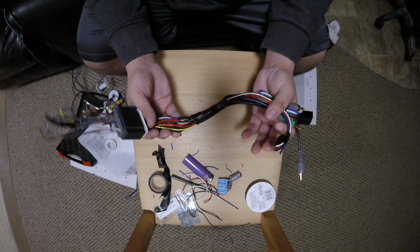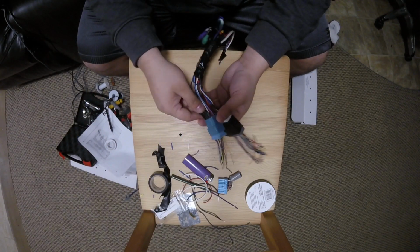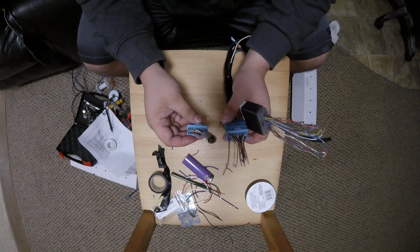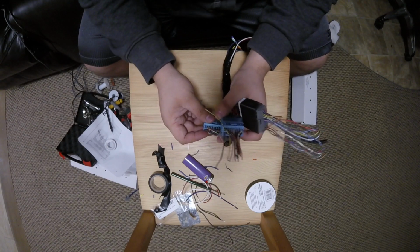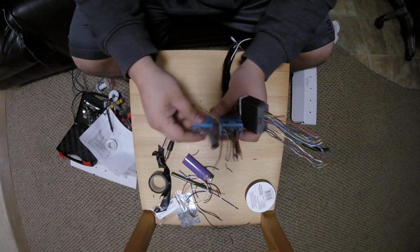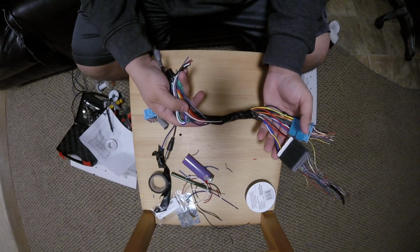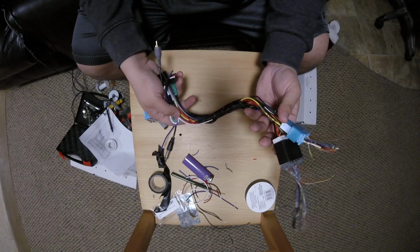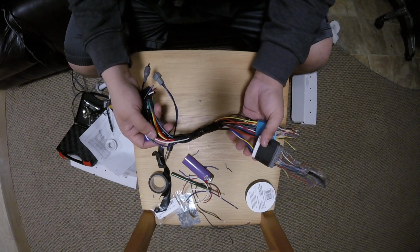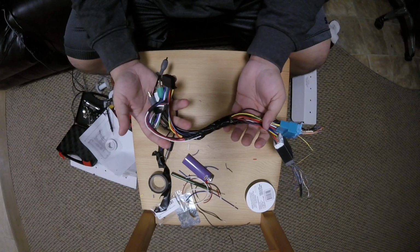It's just if you want to put the time and effort, and then the troubleshooting is really what it comes down to, because as you saw earlier in the video, the 2004s have this green yellow wire, and the 2007s, 2008s don't, because in the 2007s, 2008s, that antenna wire, which is really what it is, got moved to this harness. In the 04s, 05, 06s, they were left here. So that's something that someone who might be like, oh yeah, I could do that, I don't need to pay for that, might not know, and might end up needing because their radio signal is really weak, or some other kind of little intricacy like that, it gets lost on people who aren't fully immersed or involved in this world, where they're just trying it out for their first or second time.